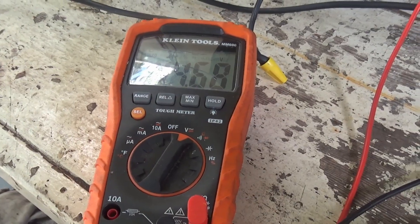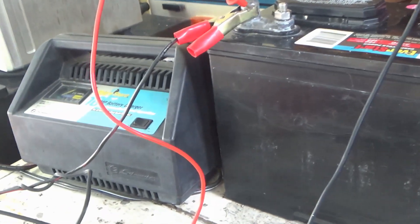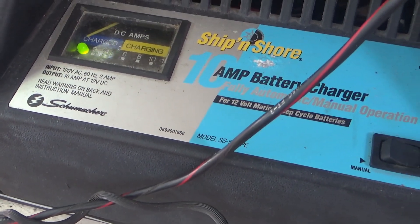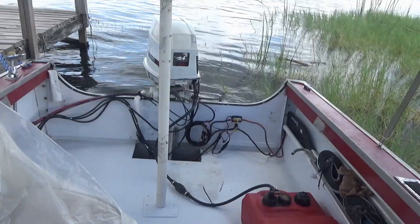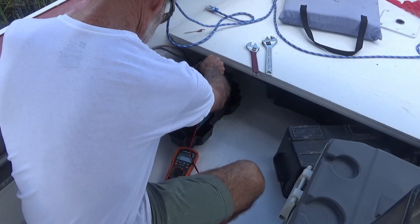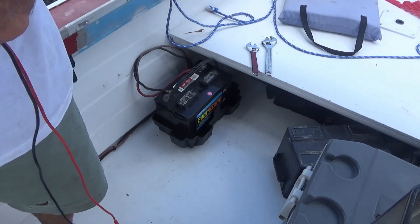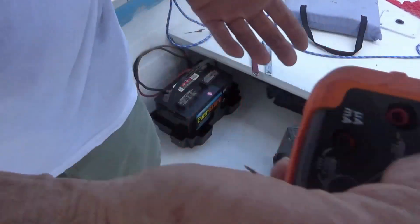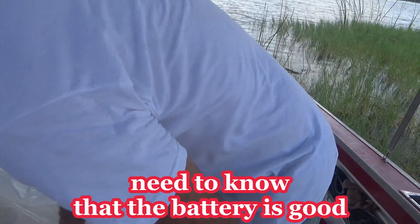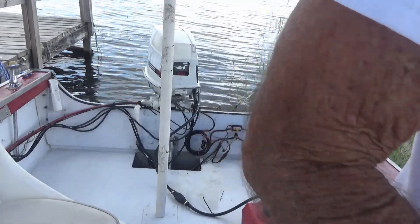Hopefully it's going to maintain and stay good with distilled water in each cell. It's back at 14.68 — come on, light up. When that little light comes on, it's almost there. It was on two when it came out this morning. My light is on — let me check this battery. Should be 13-something volts. 12.9, on the money. That's what they do — they charge up over 14 then settle back down to 12.9. We know it should start, but I don't want to go out and run it until I know that battery could have gone bad.